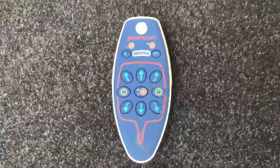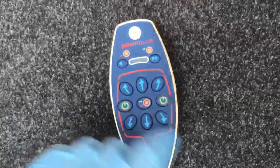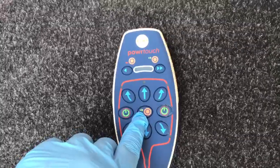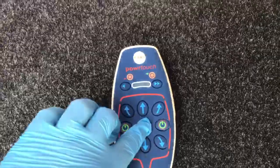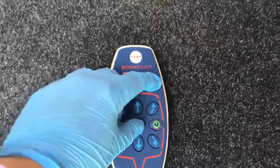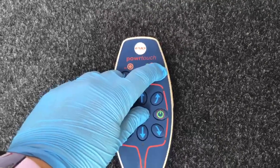To engage an automatic motor mover, focus on the centre button and the top two buttons. To engage it, use the buttons with the green arrows — green for go. Push down the orange circle button (that's the roller) in the middle, and at the same time the orange circle green arrow button at the top right. Hold them down together and the motor mover slowly engages onto the tyre at the right pressure.